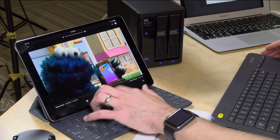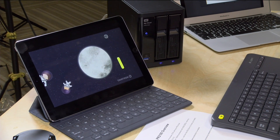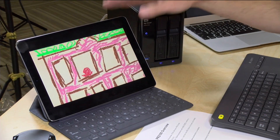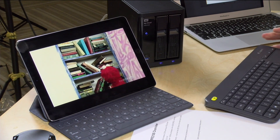All in, it seems to be working pretty well with the Plex DVR on the WD My Cloud. I've been impressed so far. I did have one crash earlier but haven't had one since, so I'll keep an eye on it and do an update if further crashes happen. My plan is to run both the Plex DVR and the HD Home Run DVR on this box together — they can work concurrently. I'll use the HD Home Run as the recording engine and the engine driving in-home television watching, but supplement with Plex to organize media and provide live TV functionality for mobile devices like my iPad. I'll be sharing those experiences as time goes on. I'll put a link below with a list of hardware compatibility for Plex hardware transcoding.